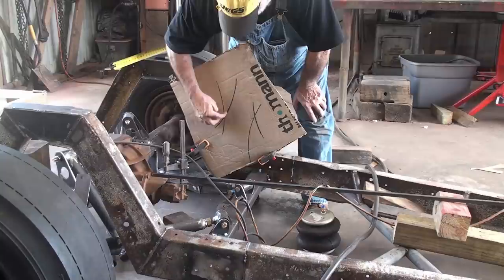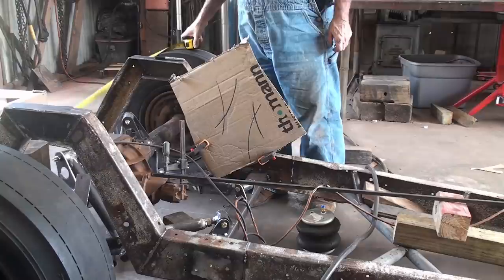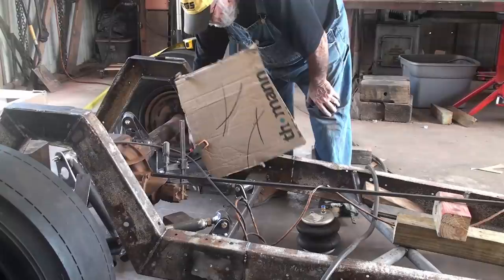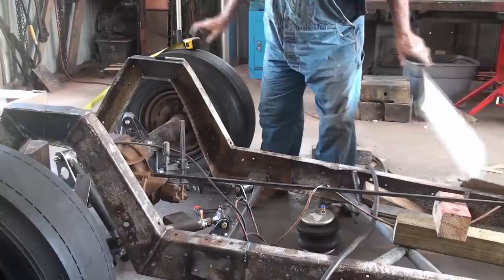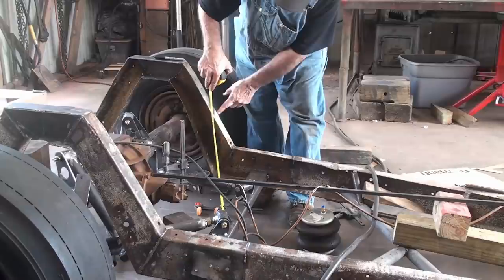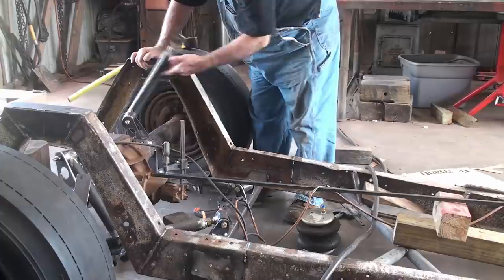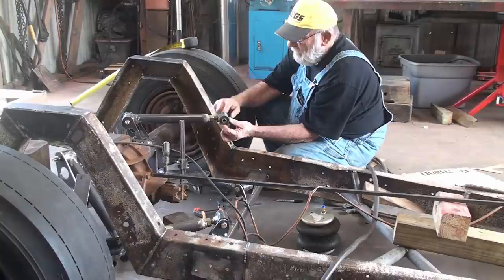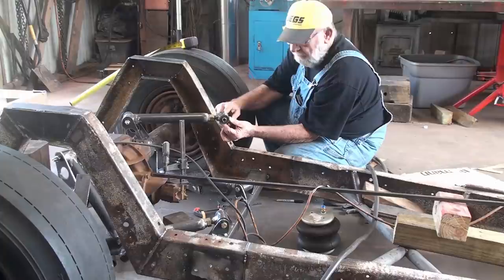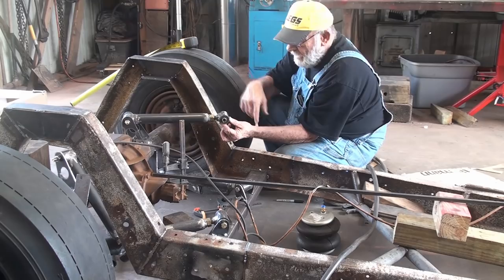I had to make a couple of changes and redo this, but it's still the same concept. This is my new mark right here, which is basically the same. So what I'll do is measure up from the floor — it's 20 inches. Then I can take this off and I'll need 20 inches. So I've got a mark on my frame at 20 inches — this is where that needs to go, and it's going to be the same on the other side too. So I'll get this eye lined up with that 20-inch mark, make a tab, make an eye for this bolt, and one on the other side, same thing. Then we'll jack it up and down and see what happens with the rear end.